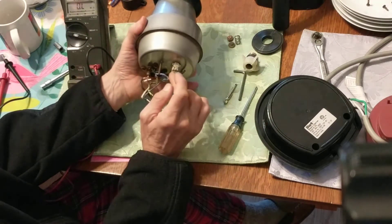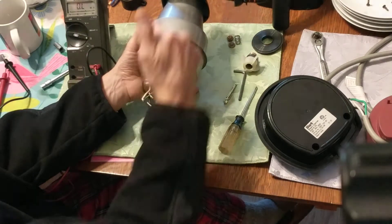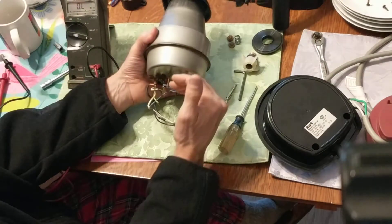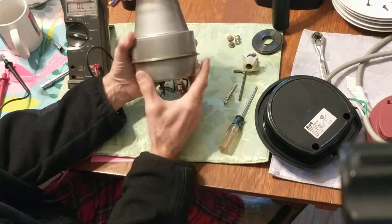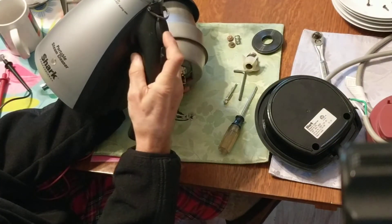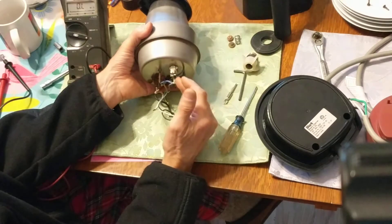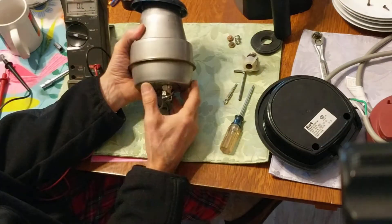The sensor is initially thermally isolated from the heating element — it doesn't trip until steam is generated. Looking in here I can't tell exactly how this particular one is set up. I don't know if this has a boil-dry feature. In a boil-dry feature there would be a way for the switch to open even when the water is gone and the element is getting too hot. As long as there's water, the heating element is cooled by its presence, but once the water is gone the element gets hotter and eventually damages itself. My guess is this Shark does not have a run-dry feature since it doesn't advertise one.